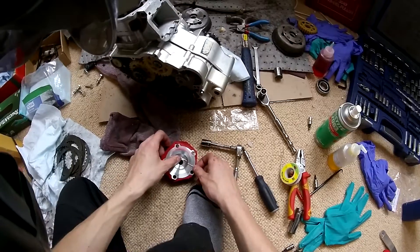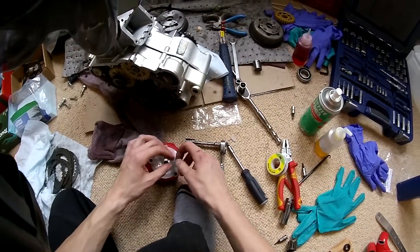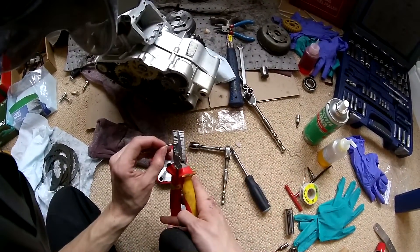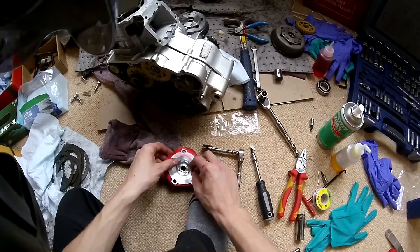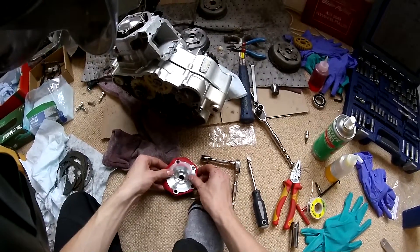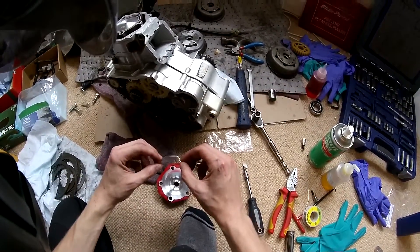You get this sort of shape. Cut that so when the piston comes up it's going to crush these two little tags aside, and then you can put your calipers on there and measure the clearance.